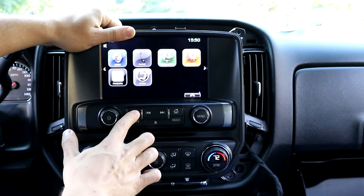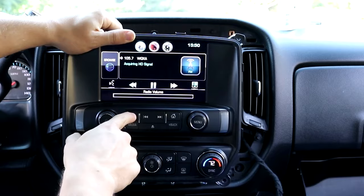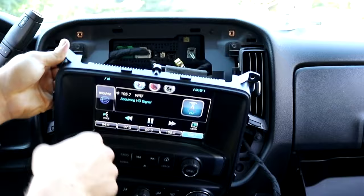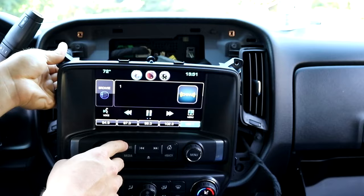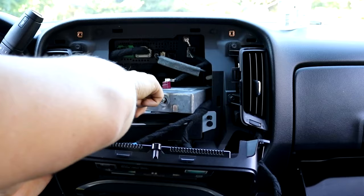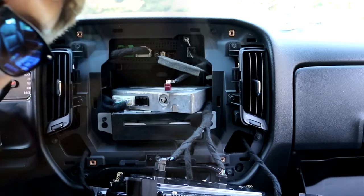I'm going to see what kind of radio signal we got. Definitely do have radio signal. Let's see if we got XM — check XM antenna. I'm assuming this is radio. We just lost signal completely. This black one is FM radio, and I'm assuming AM as well. There we got it back. Now I'm going to go to satellite — check XM antenna, assuming it's this one right here. All right. That's XM. This is FM/AM, and this is OnStar slash phone call slash OnStar navigation.